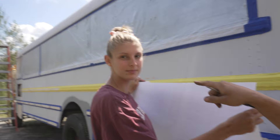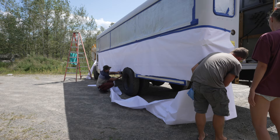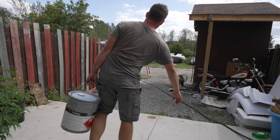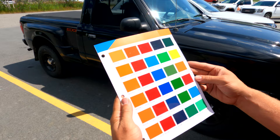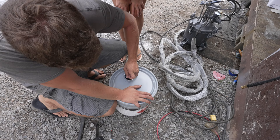Stephanie has a big roll of drafting paper, and we're going to use it to protect from overspray while we do the roof, then take it off when we do the sides. We went to our local auto body supply store and picked up five gallons of an industrial DTM polyurethane paint. The technical name is a bunch of numbers and letters, but it's basically an epoxy paint with a 4-to-1 hardener and a Q70 reducer, and does not require a clear coat on top.